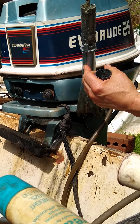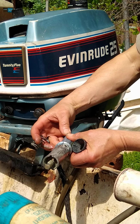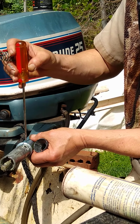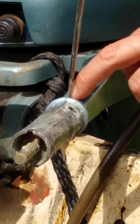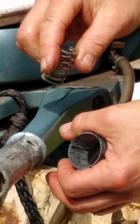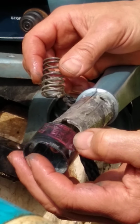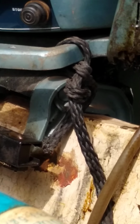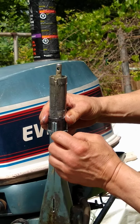And squirt some. Make sure your oil gets down and through there, which it will. Once you back these off a bit, you can take your screwdriver, open it up a bit. Mine's pretty tight yet, and squirt oil down in here for this bushing. This takes a couple drops. Tighten those back up, but not snug, and slide your collar over again. Remember, it lines up. It has a notch that has to slide over top over that.